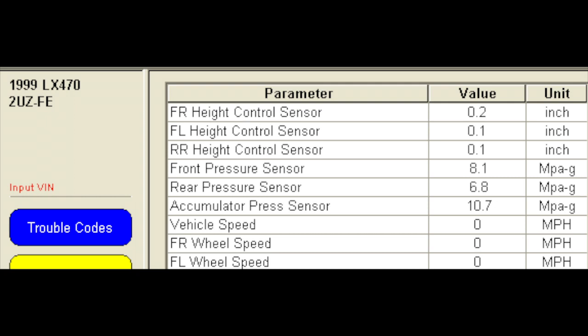This base data you can check after going from low to neutral to get an accurate pressure reading. You can see my front pressures are a bit high. The spec is 6.9 for the front and 5.6 to 6.7 in the rear. So my next step will be to crank the front torsion bars a bit and relieve some of that pressure off the front.